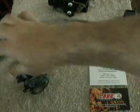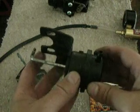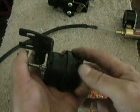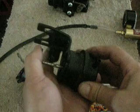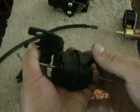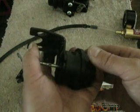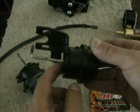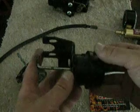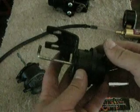One of the most popular methods for testing — that can sometimes tell whether or not you have a good one — is you push the lever in. It's a spring-loaded lever, and you push it in and push on the vacuum or suction side, which is usually towards the rear, and you put your thumb over and block it. Now if this retracts all the way back out, obviously it's got a hole or it has a leak, and this one almost retracts all the way and it hardly holds a vacuum.